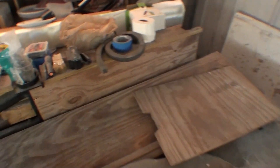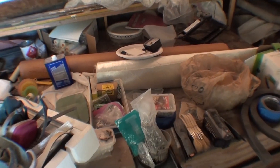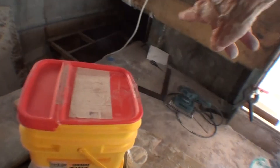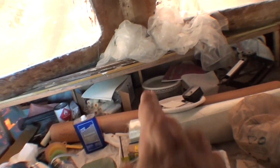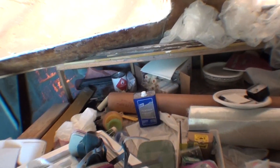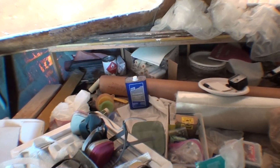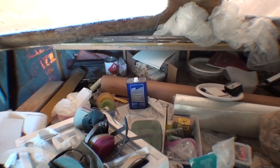All this wood — these are the bulkheads that I cut for there, there, and there. This area was going to be the bed and I was going to put the 300-pound battery there. But I'm putting so much weight at the back of the boat, I'm thinking maybe it can slide up underneath there and still have enough room for the bed here, and that way we move that 300 pounds forward.